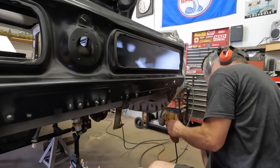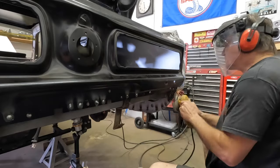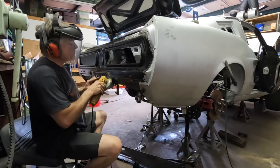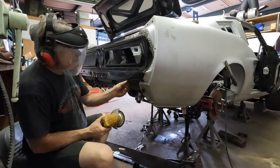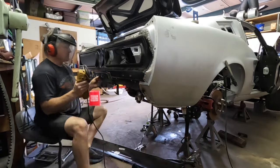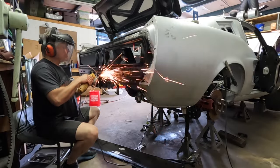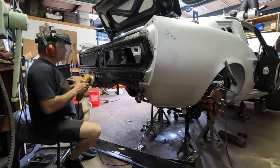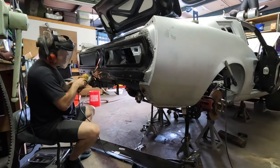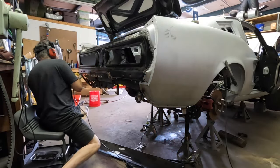This section of the tail panel always sticks out further than it needs to, so on both sides I'm grinding them down enough for the rear valance panel to sit flush. If these are protruding too far it's going to push the rear valance panel out and you'll never get it to sit flush with the quarter panels. I'm grinding down the temporary spot welds on the lower tail panel because I want to mock up the entire back section — put the end caps on, put the bumper on, and put the lower valance on to verify everything fits right before I do my final welds.